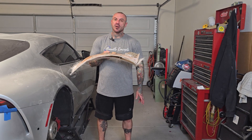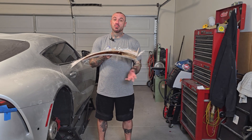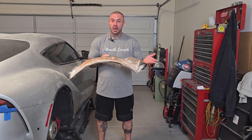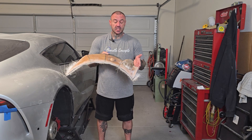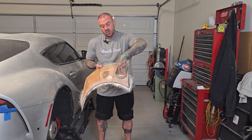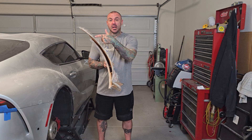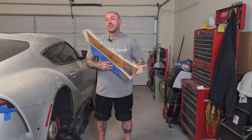Hopefully that explanation of encasing the round rod answered a lot of the questions that I've been getting — but if not, please feel free to ask. The layup for the inside of the panels — I've been doing a lot of fiberglass work and it's nothing you haven't seen me do already. Next episode, what we are going to be doing is actually finishing off encasing these parts. All the sections with the ports will have to be blended out, the bottom of the wing is going to have to be fiberglassed, as well as the main wheel arch. So at that point, these panels really will be fully encased.